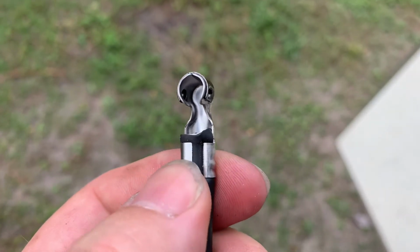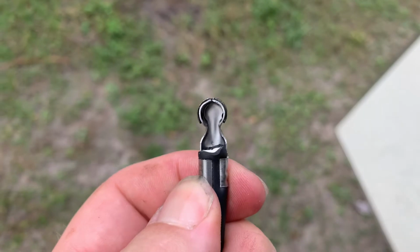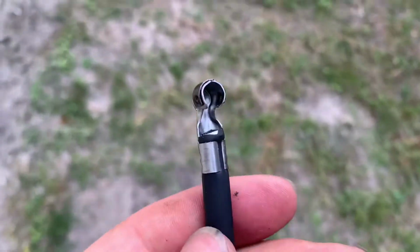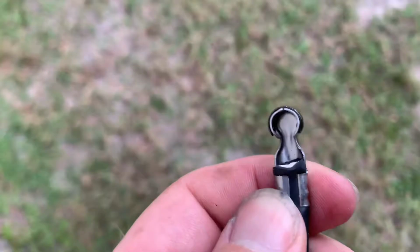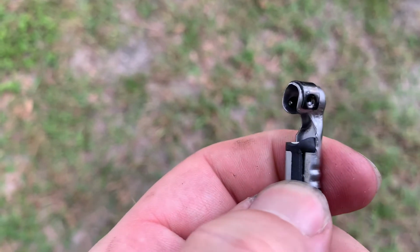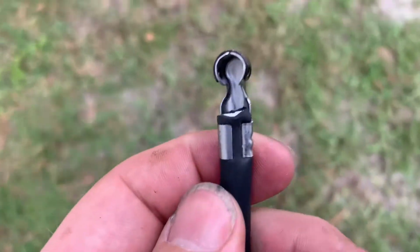So again, this one I wish I would have spent a little more time, but I'm trying to do it for the video. It would have crimped down pretty much perfectly. So if you just take your time and use those pliers like I started to do a few minutes ago, and get them where it's just barely touching, like I did, once you put it in there and go slow, it'll smash these down. Really, all that happened here is this side should have done the same thing. And literally, taking my time yesterday, I did not have any kind of challenge like that.